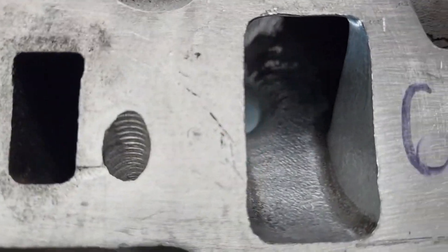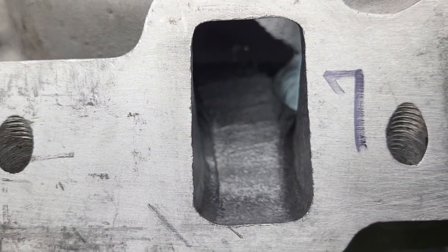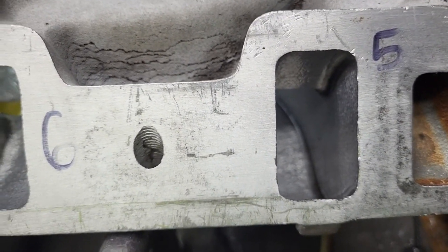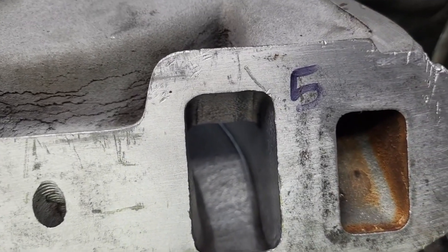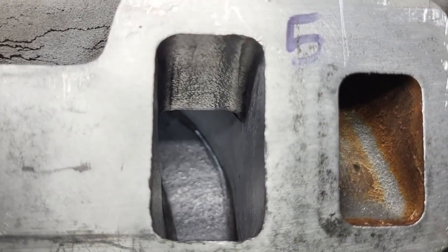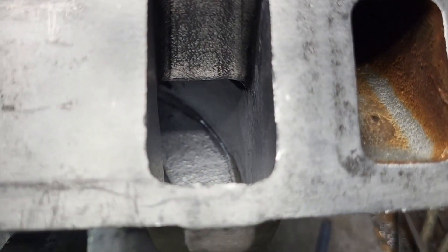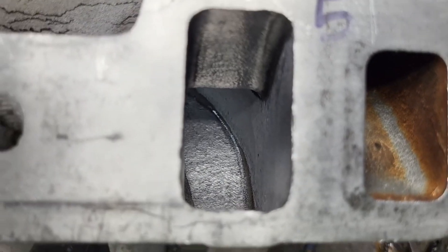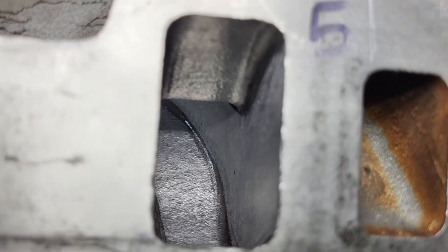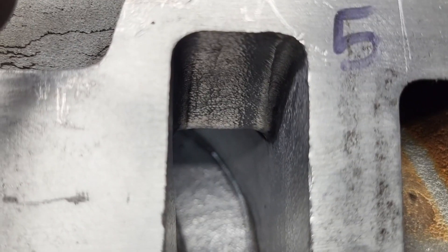This is the lower half — that's 6, lower half, 7. Runner 5 was really rough. Runner 5 is the one we were flowing through the head and all. Unfortunately, all the way back there, there was all kinds of slag on that back wall — it was really having a hard time. You can see it's still an extremely rough texture. I'm having problems using the very tip of the burr to do a finish because these are so deep. I'm going to have to work on my technique for that.